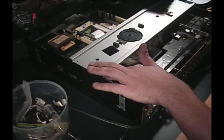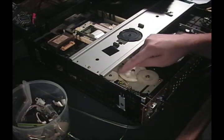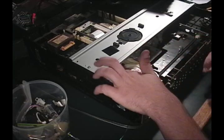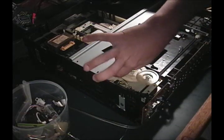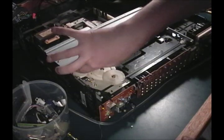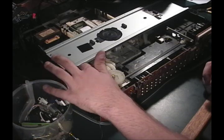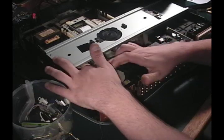It has to go through its full cycle before it will actually start. I got these gears lined up. If you notice on this one here, there's a cam on it which coincides to a cam underneath here, as well as a gear underneath here. So this reaches the end of its travel — right there. So you spin this, and right about there the drawer would be in all the way. And then at that point, notice it pulls that down and that whole mechanism raises right here. So the trick is to get these all in sync the way they need to be, then get the tray in there at exactly the right tooth. And I did that.